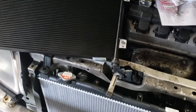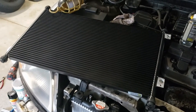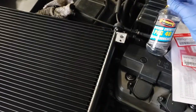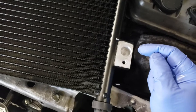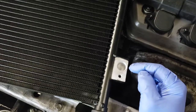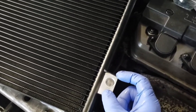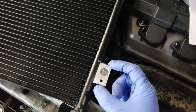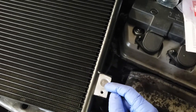However, because this car was in an accident we don't know how much oil was in there. I think all the old oil just leaked down onto the ground and I just put a couple ounces of this in the condenser. This is where a lot of the damage occurs — the more these lines get taken apart the more they get scratched. It's really important that when you try to disconnect it, you disconnect it straight off, so you want to wiggle it — don't pull it to one side or else it's going to scratch on the inside.